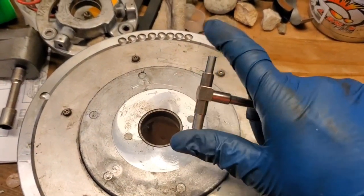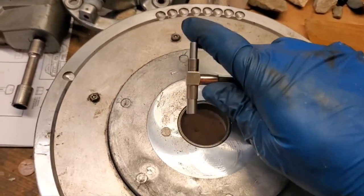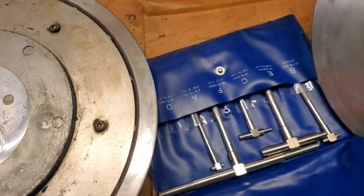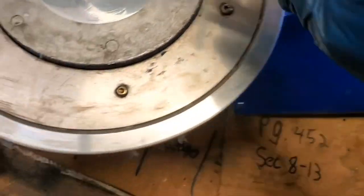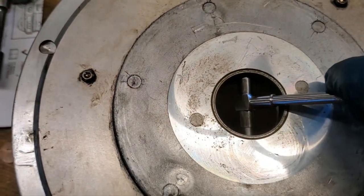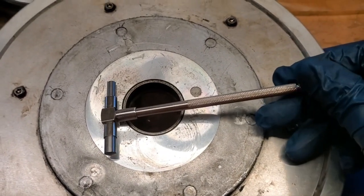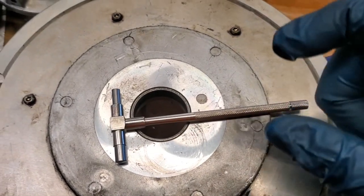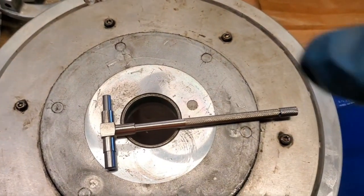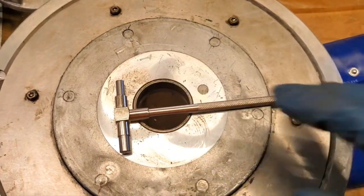to my bushing here, and I'm going to use one of these bore gauges, okay? So basically how these work is these are spring-loaded. So they come in a variety of sizes from Harbor Freight like this, depending on which size you're measuring. But basically, I get that in there. And then, again, hard to do off camera. Turn this little dial here, and it'll lock it in place. So once that's locked in place, I'll pull it out, and I'll measure across here with my caliper to see what that measurement is. I'll write that down.